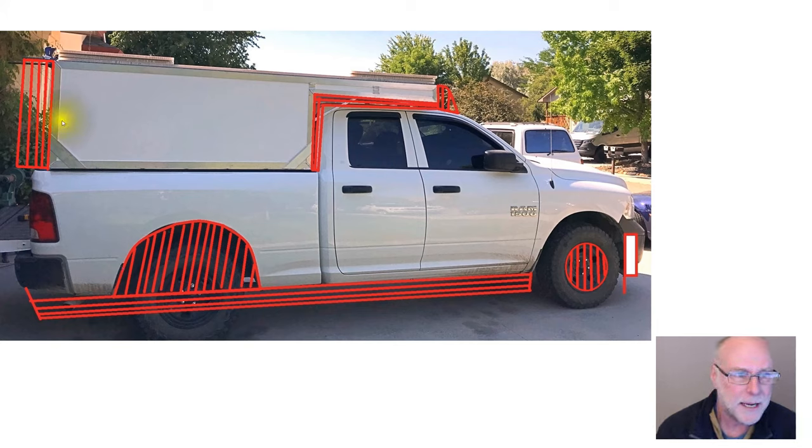At the back of the vehicle body — this added body — I'd put an extension down each side and also one across the top, forming effectively a box cavity. That disrupts the flow behind the vehicle a little bit and stops some of the flow patterns developing that otherwise can cause drag. We could do that on the vehicle's original body work as well, but then it makes it hard to see tail lights from different angles, indicators and so on.